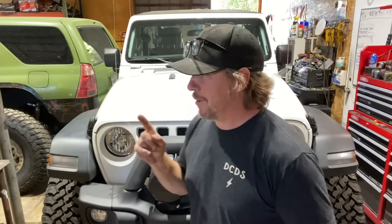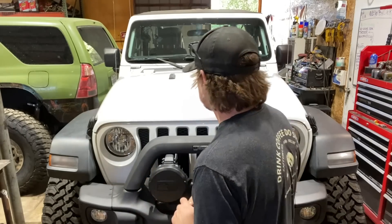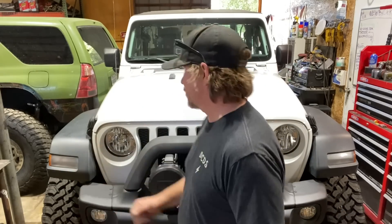It can also do a bunch of other funky things — like right now this Jeep has normal incandescent lights on the fenders. If I wanted to upgrade to the LED package, or if I got some Rubicon flares with LED turn signals or LED headlights, this allows me to adjust for that so it doesn't get all super flashy, which can happen if you don't have the right flashing mechanism. It can change headlights and tail lights from incandescent to LED, deal with the factory halo ring, and make your fog lights come on with your high beams — because normally fog lights and high beams don't run at the same time, but you can make those two work together.